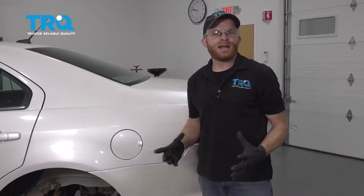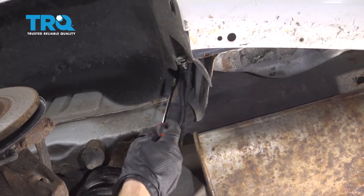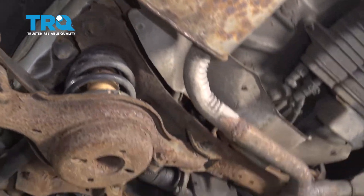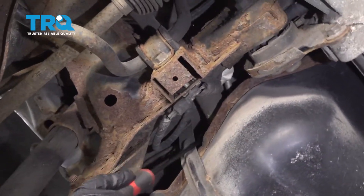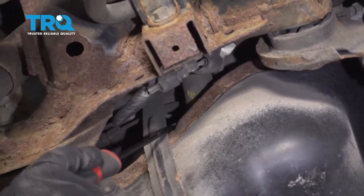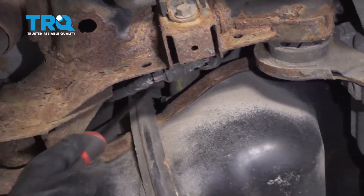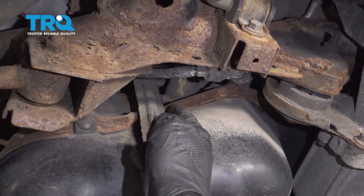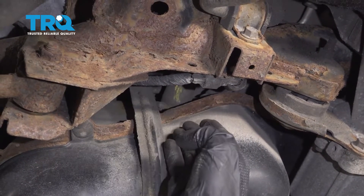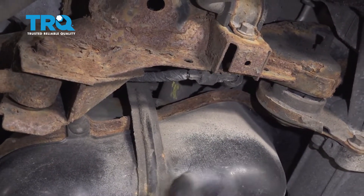Now if you were sitting a little bit over half a tank, typically what you're gonna wanna do is try to siphon some of that fuel out. To drain out your fuel, you would just wanna follow your fuel neck all the way down till it reaches the fuel tank itself. You're gonna see a rubber hose that connects onto it with a clamp. Go ahead and remove that clamp, or at least loosen it to the point that you can remove the hose from the fuel tank. Try to drain out at least half of the tank of fuel. If you're already sitting at a half a tank or less, you're all set and you don't need to do this step.